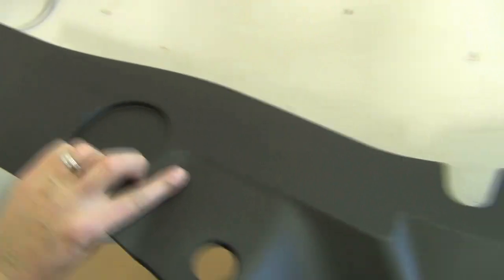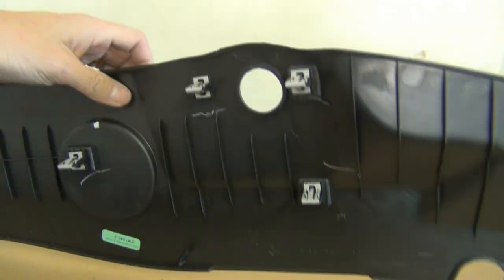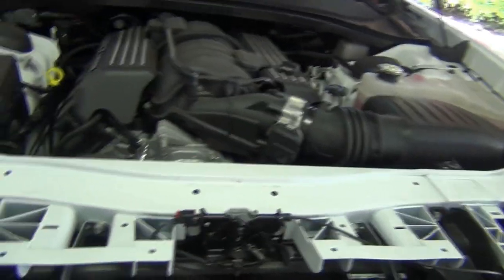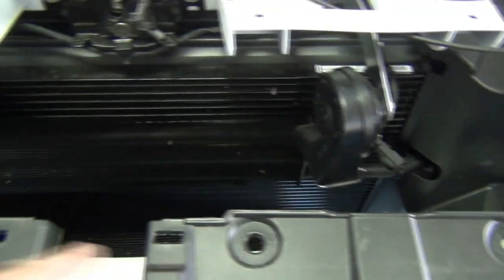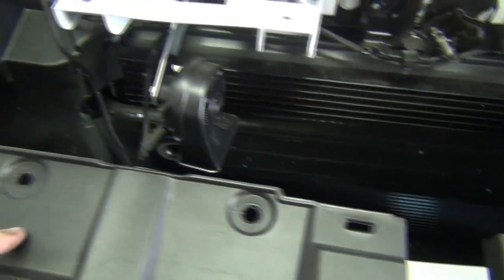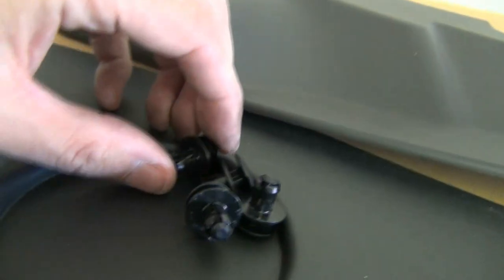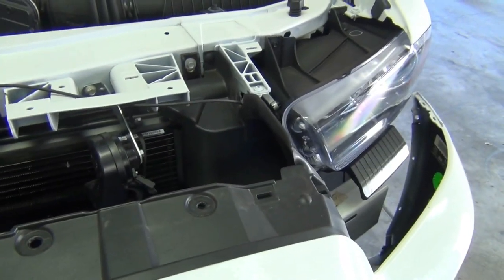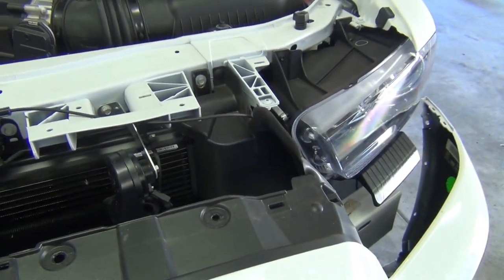For the top side with your cup holders, those just snap right off. You just gently keep pulling up until your two cup holder covers come off the top. Then the last four snaps on top — I'd actually do these first, but it depends what order you go in. So once you've done the four top snaps, five or six along the bottom, and all the fender side ones, you just pull and it comes right out. It's that simple.